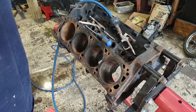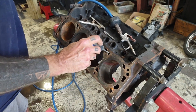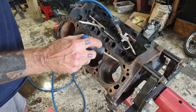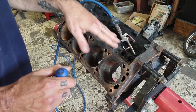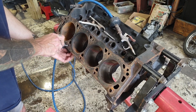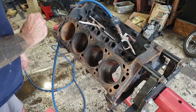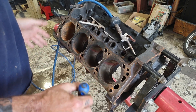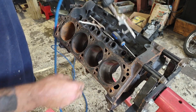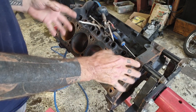You want to know where your bolt holes actually go. Usually take a thin screwdriver — all the ones at the top bottom out, so they're all blind holes. Dirt accumulates down in the bottom. The ones on the bottom go down into the water jackets — I'm sticking my finger where the freeze plug would be and I'm touching my finger with the screwdriver. So these all go into water passages, which means there's most likely going to be excess corrosion on those. For these blind holes up top, take some compressed air and blow them out to get the debris out.